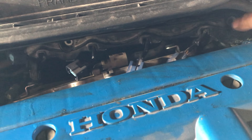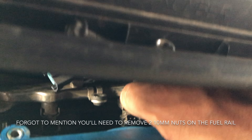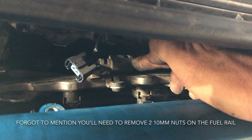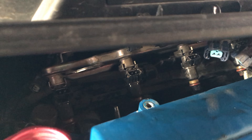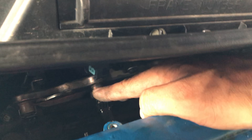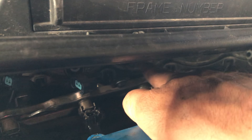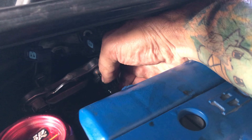It doesn't actually come out all the way since it's hardwired, but I'll give you enough room to push it back. You can also decide to remove the fuel rail — there's a connector right here which is a feed line. With some force just pop it up. The injectors are then exposed so you can pull them out and swap them with whatever size you want, or take them out to clean them. Then unplug that backside fuel line as well.